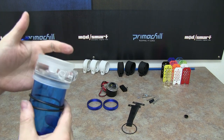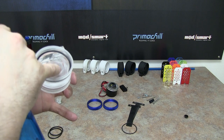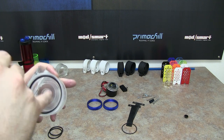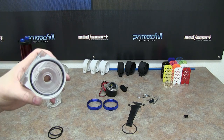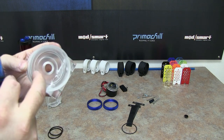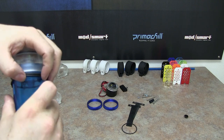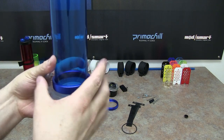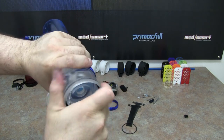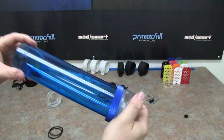The pump head can go either way, but not really because this is the pump side. The pump side has kind of a helix to it — it spins out and the fluid comes out this way. As your pump revolves, it inlets from here and then spits out to this side. You don't want to install your tube res on the outlet side — you want to install it on the side that has the lip in it. We slide the two O-rings up and then sling the ring down and tighten it by hand.